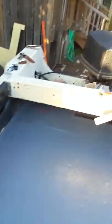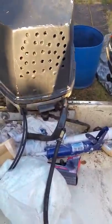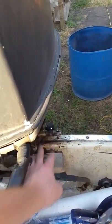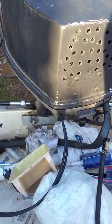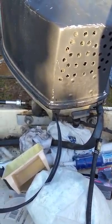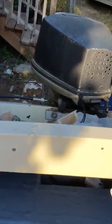The next problem: we started this engine and found out the steering was stuck. So I undid this and this all moves freely — I had that out yesterday. But this rod over here is stuck. It has no grease or anything on it, it's completely dried up. I put some WD-40 on it and I'm going to hammer it out. As you can see, when I turn the steering wheel, this whole side works and the cable comes out, so I know the cable itself is working — it's just inside here somewhere that everything is sticking.